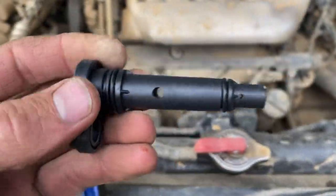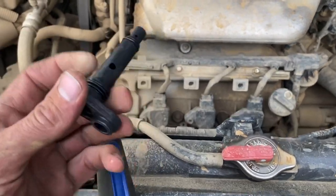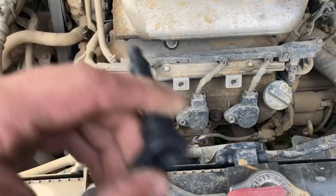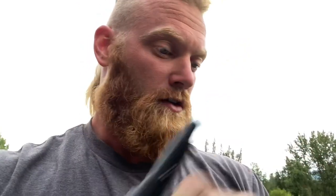Definitely putting that one in there. Make sure you lube up the O-rings with some oil, then go ahead and slide it in there and bolt it back up. With these PCV valves, make sure that it does that — because it'll get stuck open or shut. I actually bought one online for about half the cost, like $20 or $25, but I opened it and shook it and it didn't make any noise. So before you take your old one out, make sure that it rattles like that.